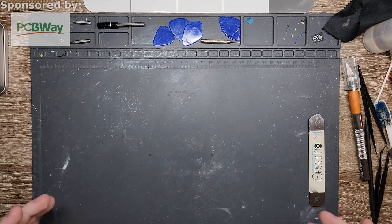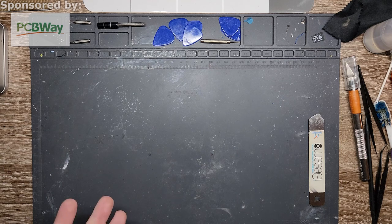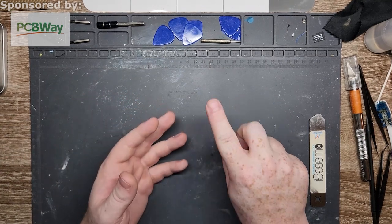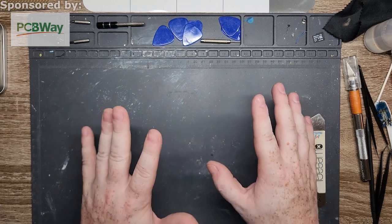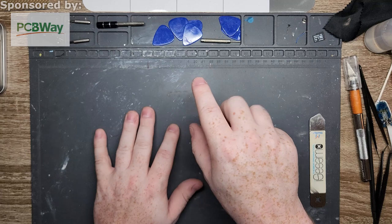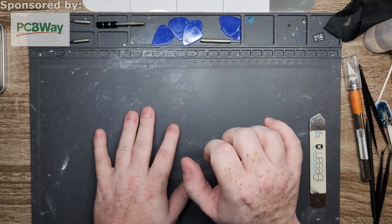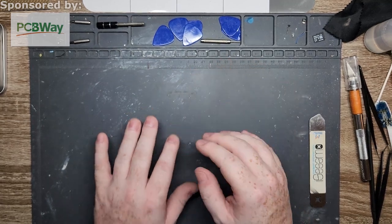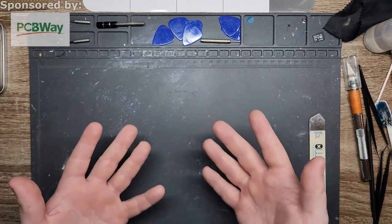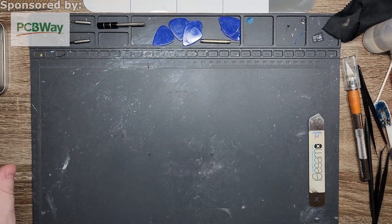Right now, today, what we have is an iPad 9 10.2-inch screen, model A2602, and this has a broken screen, or a broken digitizer. Because if you remember, iPads have two parts. For most iPads, they have two sections that are replaceable. You have the digitizer, which is the glass and detects your fingers and whatnot. And then you have the picture underneath, the LCD screen, which is replaceable but more expensive. That just provides the picture, though. In this case, it is just the digitizer.